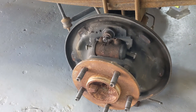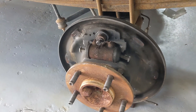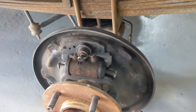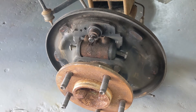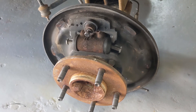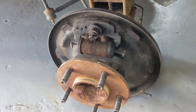So, with this kit, it is designed to not require you to remove the axles to install it. But you do have to get the backing plate off, and — guess what — you can't do that if your axle's in. So they recommend that you cut it in half. Easier said than done. That was my experience. So if I were doing this all over again, I'd probably just remove the axles. You can replace the differential fluid at the same time — it's probably not a bad idea. However, I already did one without removing the axle, so I'm going to do the second the same way.